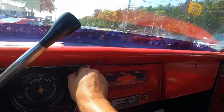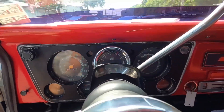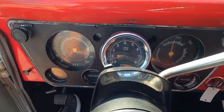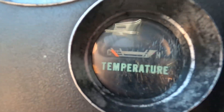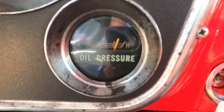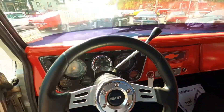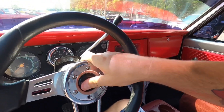Got a good sound to it. Wipers - they are working, missing the knob there on top. Turn signals - they're not blinking on the left side, not blinking on the right side. Doesn't mean they're not working on the outside and we'll be checking that throughout the video. Tach coming up on the dash. Engine temperature - I have not let it run quite long enough to come up, but it may not work either, we'll be checking it through the video. Oil pressure is moving and it's on the high side. Fan not working. What about the horn? Something about a Grant steering wheel - nobody ever hooks the horn up. Let's hit the road.